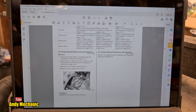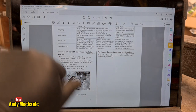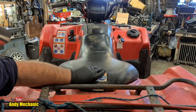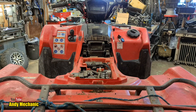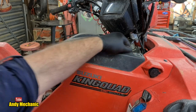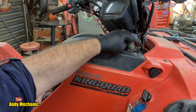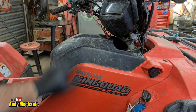Seat off - dead easy, little latch at the back. That's that out of the way. We need this cover taken off, so we've got some push pins or pull pins - plastic rivets, call them what you like. Pull those out at either side and there's a couple more down this end as well. We'll get those whipped out and get that cover off to reach the air filter.